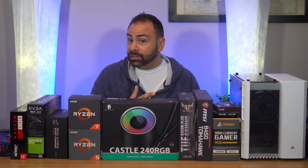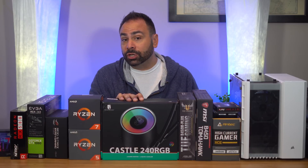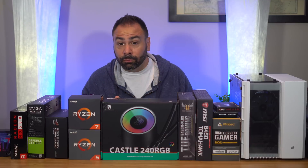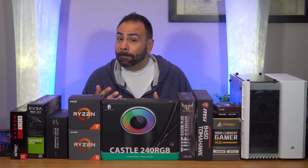Whichever processor you choose is going to be working hard. Core utilization while exporting videos is often at 95% or higher, and as some exports can take 20, 30 minutes, or even an hour or more, you don't want your processor roasting and throttling. So for our build today, we're going to use the new Deepcool Castle 240 RGB cooler. The RGB specifically makes you edit faster — everybody knows that. But besides its killer looks, this 240mm radiator should do a great job keeping our CPU at a reasonable temperature. If you go for something like an 8700K or Intel's HEDT parts, you might want to step up to a 360 instead, as those can generate a lot of heat.